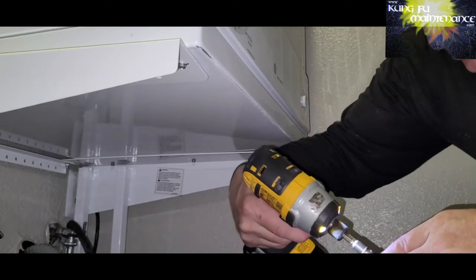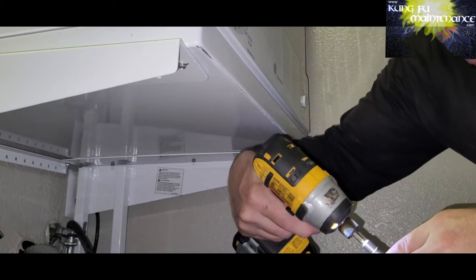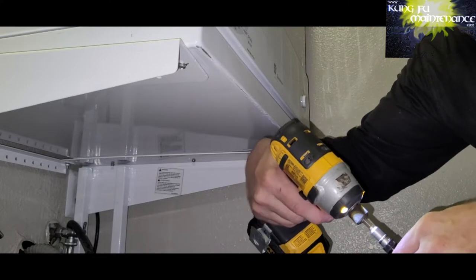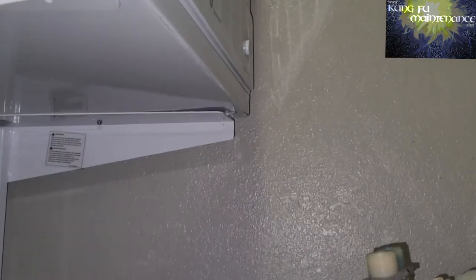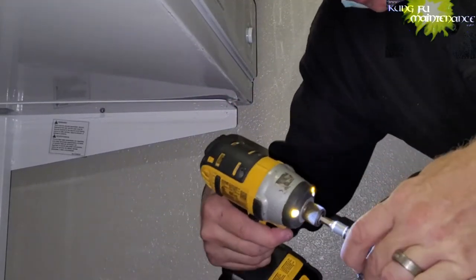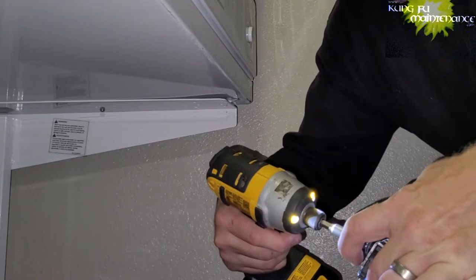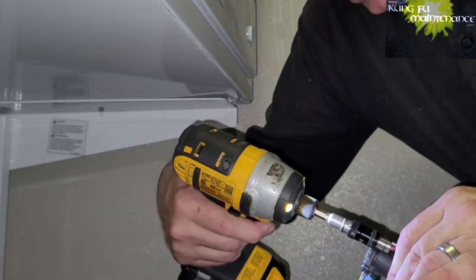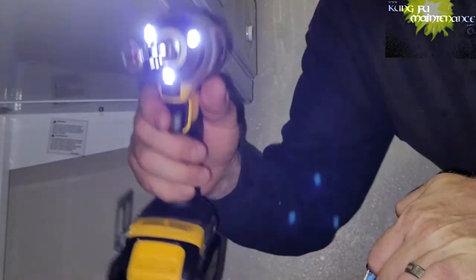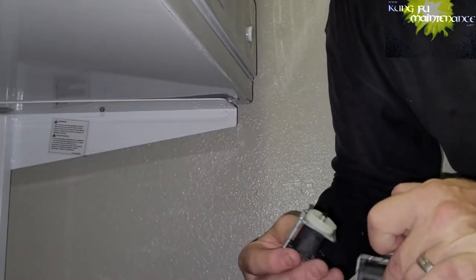Now we can move that cover plate, and then that gives us access to the solenoid valves. This one, I'm actually pulling the screws out to remove that hot side solenoid valve. It's got four screws around it. And you can actually pull the solenoid valves straight up. They have a little gasket that inserts. But yeah, there's four screws that hold the solenoid valve on. So carefully removing those screws, and then I can pull the solenoid assembly out.